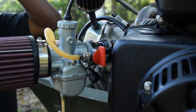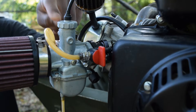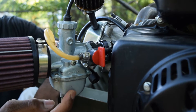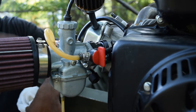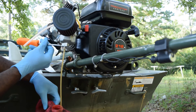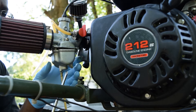Quick review on the carburetor work. I moved this clip down to the second clip from the top. We have a leak here in the float bowl, and we need to put in the number 15 idle jet because the number 12.5 just can't deliver the fuel. A simple turn of the screw, and the gasket material is just gone.